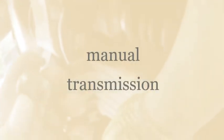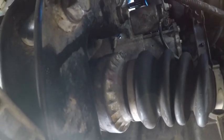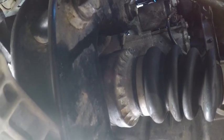Underneath the car now — here's how the plug looks. It's a 13 millimeter and it's right at the corner where it curves at this mount. That's on the other side, right there. You can get a clear shot with an extension. I tried checking somewhere else and finally found the location of it.